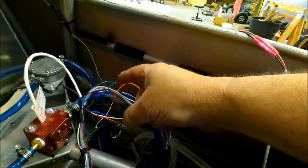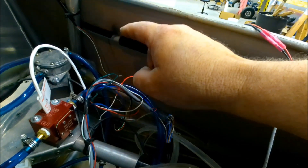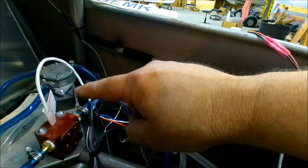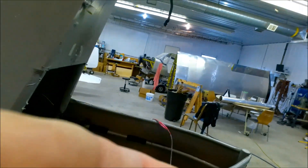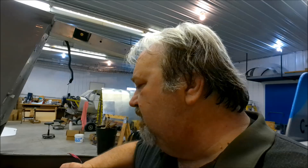This wire over here, which is cut, is coming from the fuel pressure sensor. What I did was I measured the voltage when it was 0 PSI, and I measured the voltage when it was running at whatever the pressure was coming out of there. I was really more concerned with the bottom — the 0 PSI setup. According to the manufacturer, that sensor will have 0.5 volts at 0 PSI, plus or minus 10%. At the top end it's plus or minus 2%. I was getting 0.45 to 0.46 volts at 0 PSI, which was within specifications. But my EFIS was showing 1.7 PSI when there was 0 PSI. The top of the scale was showing pretty close to correct, but the bottom of the scale wasn't.